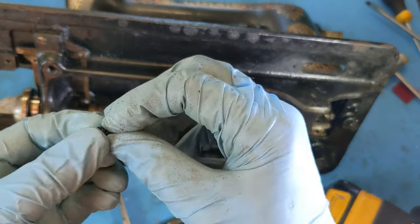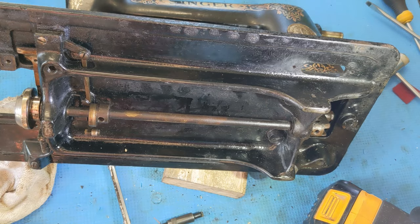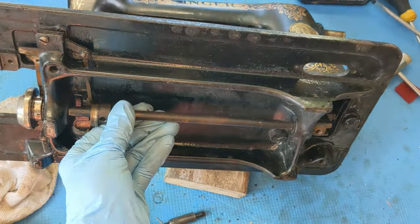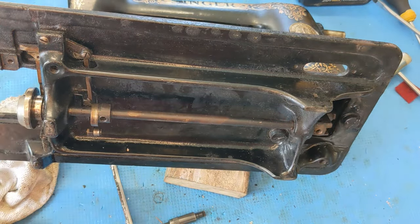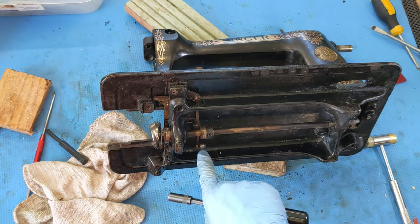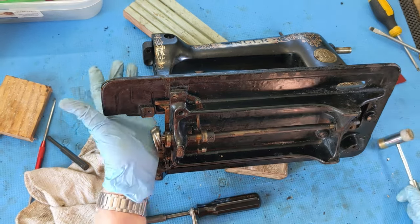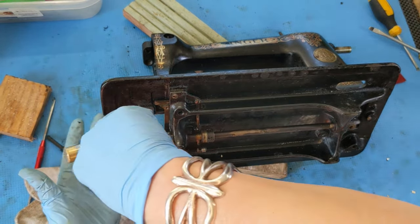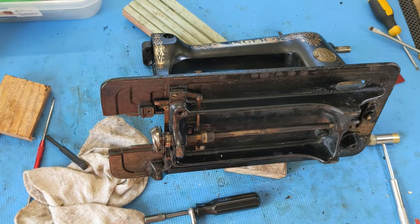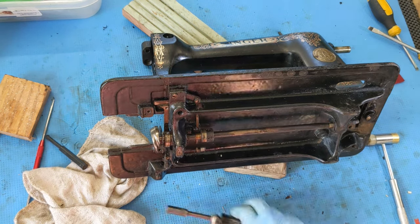All right, and this is another little dimpled piece. This has a dimpled screw. I'm going to set it on the other side of my dish over here. And get a little hammer and see if I tap lightly if anything moves. It turned. When I turned it, I see there's another little set screw right here. So before I go any further, I am going to tap it back just a hair to take the pressure off this little piece and unscrew that one right there. Okay.